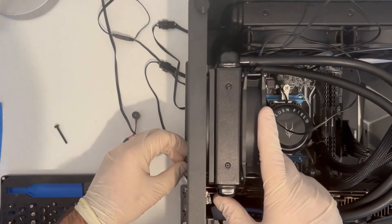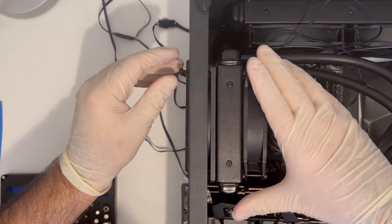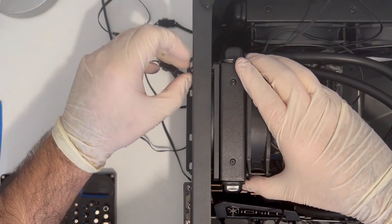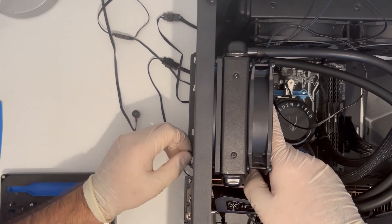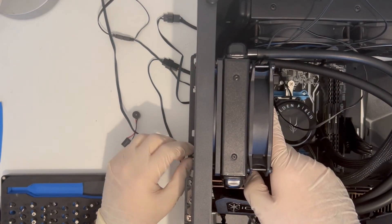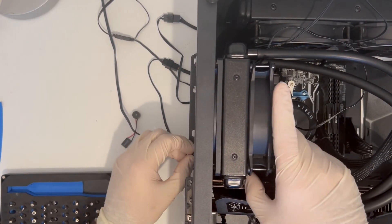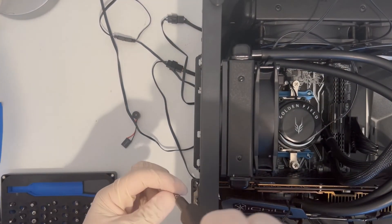Initially, I installed an Arctic Silent Fan connected to 12V on the exhaust side as a failsafe, in case the PWM fan linked to the CPU on the intake loses the profile I set, but that proved to be insufficient. I swapped the Arctic Fan with a Corsair Pressure Optimized Fan, and that made about a 12°C difference, with the card topping out at 71°C in a 19°C room after 30 minutes, so I will definitely take that.